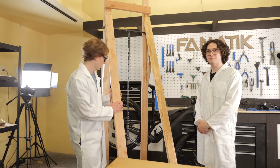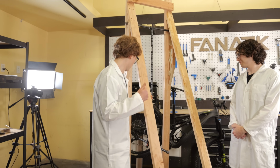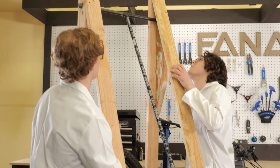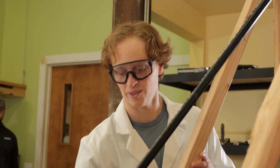Okay, so here we are. First round of derailleur whacking on Kyle's XX1 Axis derailleur. Let's get things going. Where are we at? Does that look pretty good? Go a little more. A little more. That looks good. It's reading 40 degrees off of vertical. 40 degrees off of vertical.